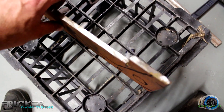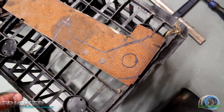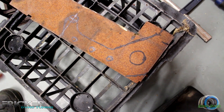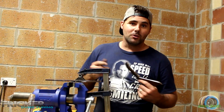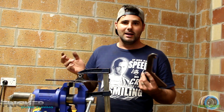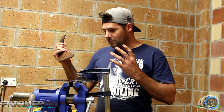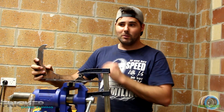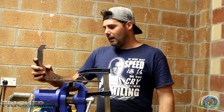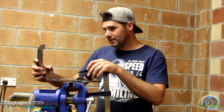Okay, so this is my bottom bracket — roughly this shape, I'll clean it up a bit. Then I'm going to drill some holes in it just to give it a nicer look, weld it all up. I don't have to be as accurate with this — that's the beauty of doing the top bracket first. Once the top's done, the bottom's really easy. Sorry guys, I didn't end up recording any of me making these little brackets — it's just metalwork with the angle grinder, very straightforward. It's back in the jig now, so I'll weld this one up, put the supercharger on, sit this roughly where it's meant to be and weld it on, and then it's ready to go back on the car. I'm probably going to get this sandblasted and powder coated if I can convince my mate. But that's pretty much it — really basic. We'll move on to weld them all up.